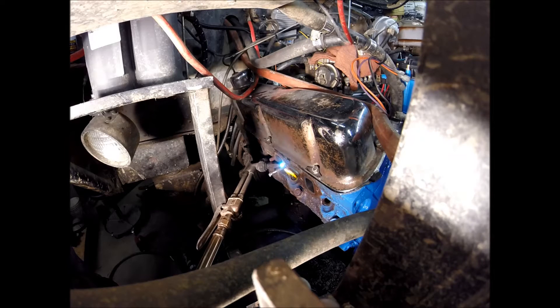Just focusing the heat at the casting in the exhaust port, trying to heat the area around the stud. We want to keep the stud as cool as possible. We'll be hitting it with the Loctite Freeze and Release after. You want to heat the cast iron around it so it will expand away from the stud, breaking that contact. I wouldn't be doing this on a professional race car — this is kind of a junkyard motor to me. On an aluminum head I would be very careful or not even try this method.